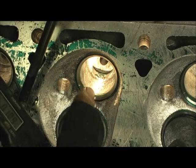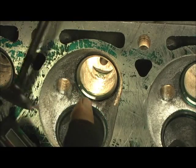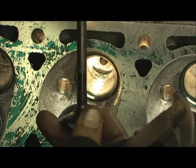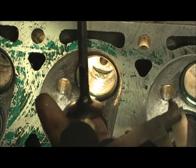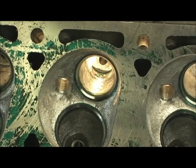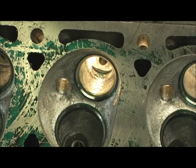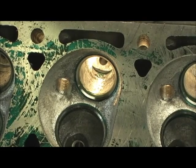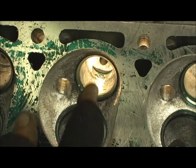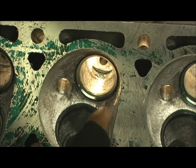So I'm going to have to go in there and redo the three-angle cut after the guides are hand-honed, to make this thing what it's supposed to be — or else carbon will build up. Within three or four thousand miles, this thing's going to have a problem sealing because it's going to be so wide that carbon will lay in between the face of the valve and the seat. When you buy these mass-produced cylinder heads or replacement heads, all you're getting is a casting. The guides have to be done, the valve job has to be done. It's just poor quality of workmanship — these probably come from China.